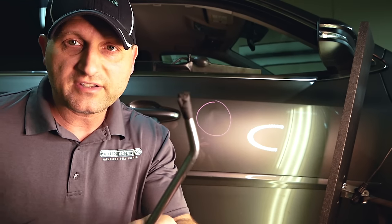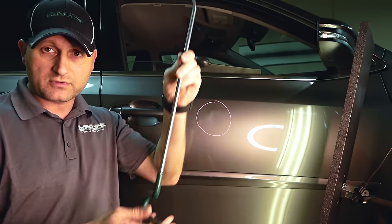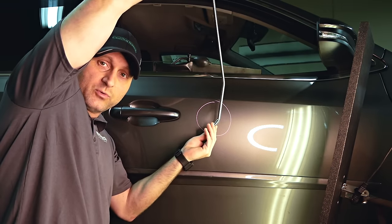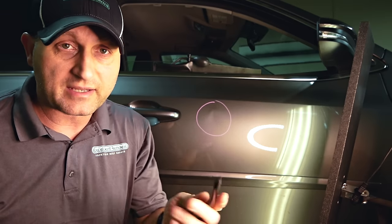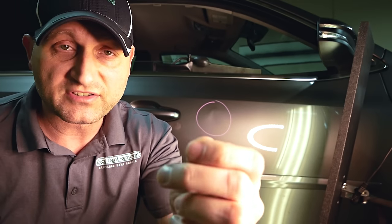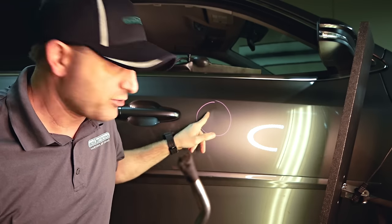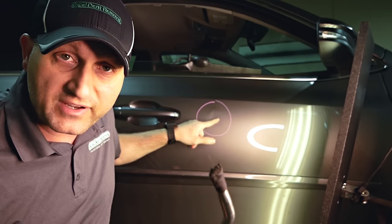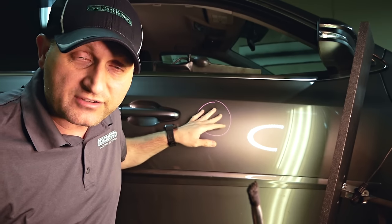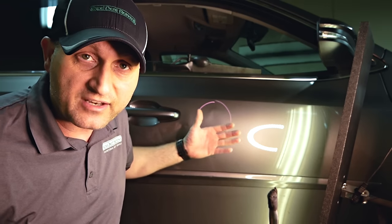This is the first tool — a paintless dent repair tool with a little bend in it, so when I go down the door I can do some twisting and turning to push down on the damage. You can see I have some tape on the tool to soften up the tip. If I used a sharp or pointy edge, with the pressure of these crowns it would actually push that damage up very sharply and cause a lot more damage down the middle of the dent — you just wouldn't be able to flatten it back out.